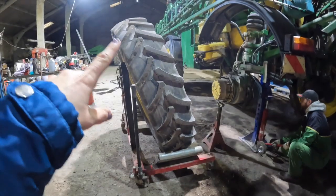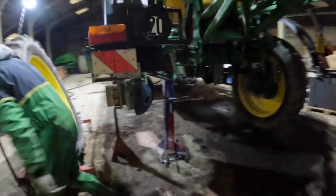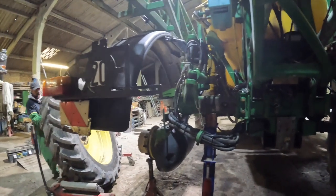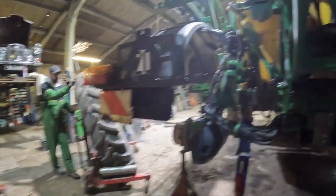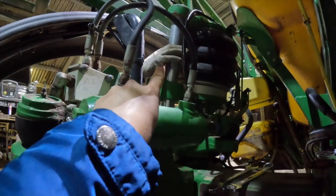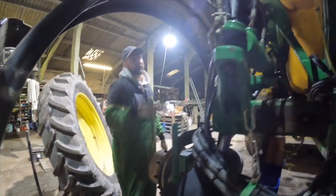We did just do a little live, guys. Obviously what we're doing is Daniel is taking the wheel off — there's something in here that needs fixing, a suspension bush, not a bearing. You know it's gone because there's a bit of rubber, the seal's come out. Once the seal comes out you know the bush inside is fairly worn out.